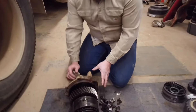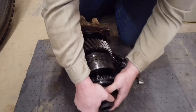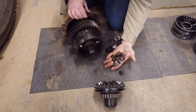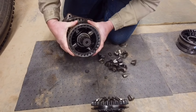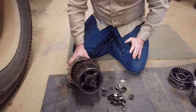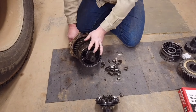You're going to pull this right out of the rear end, and it's going to come out with a yoke on it. Then you've got this shift collar and this gear that's going to stay up in here. All these pieces were the spider gears that came in here, and it stripped the input shaft. The drive shaft was spinning into the rear end and the truck was going nowhere — we had to tow it in. It's a very simple fix and I'm going to show you how.